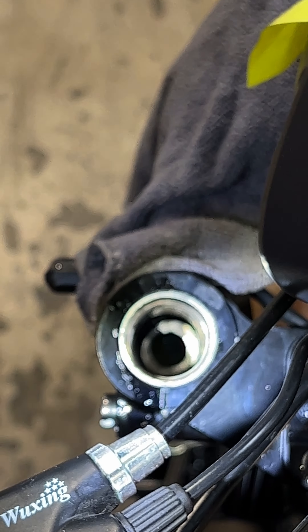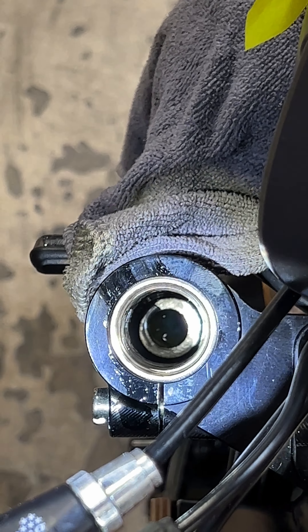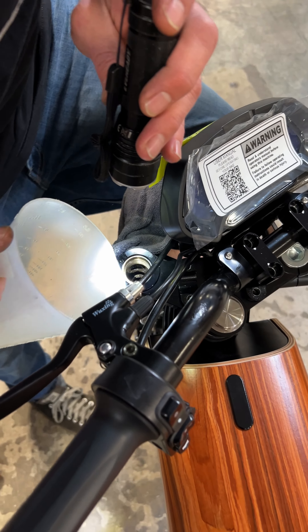So now if I push it all the way up, you can see the level is a little bit low. The oil should be totally covering that spring, after we separated the spring from the hollow piece.